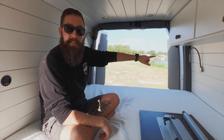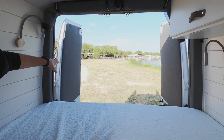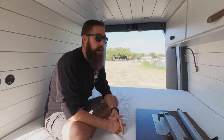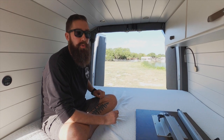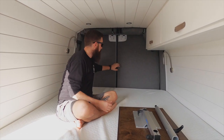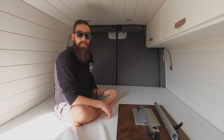Same light on the passenger side as well. The back doors are fully insulated on the inside and finished off with the same material as the rest of the van. We found that when you're sleeping at night and you reach out and touch cold metal, it was a very unpleasant feeling. So from now on we've always finished off all of our van's metal around. This really helped with that — just so you don't have that harsh cold or moisture build up. This kind of acts like a big headboard — it's insulated, it's a quarter inch plywood plus batting plus fabric on top of it, so it's really nice and cozy at night.